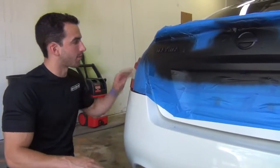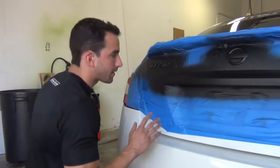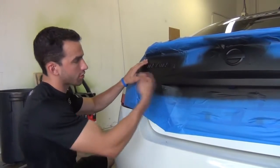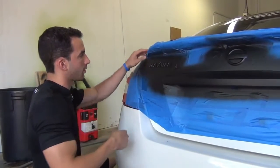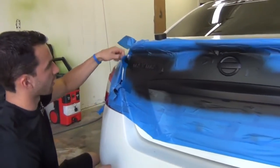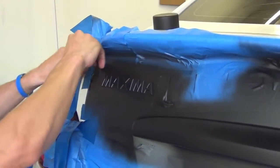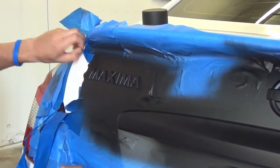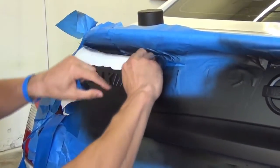Now we've got four coats of dip from all different angles and we've given it about 15 to 16 minutes to dry — it's plenty of time, dry to the touch. If you start too early, when you go to peel the Plasti Dip up it's going to be too soft and not have any strength. So we're going to start removing the tape around the edges and work our way into the Maxima sign area. I prefer to release the tape around the Plasti Dip so we're not really bound to the line of the tape when removing it — just keep your finger on it and peel it off.